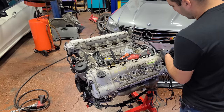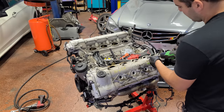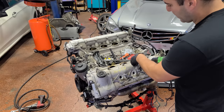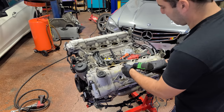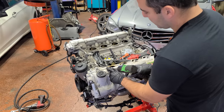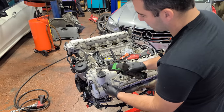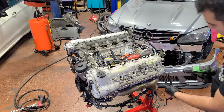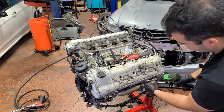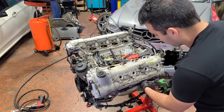All right, people, say a little prayer for the cams. The camshafts were another common failure point. Typically because the tappets would fail and beat up the cams. But either way, the cams could be in rough shape. And they are very, very expensive to replace. Not to mention that we're not gonna get them in the next day. And we are on a crazy time crunch for me to drive this car back home.